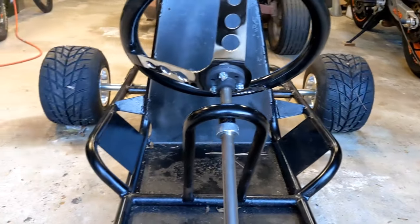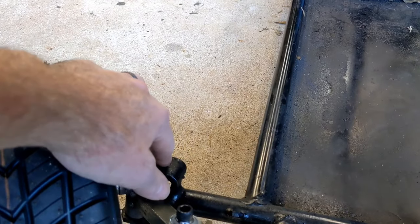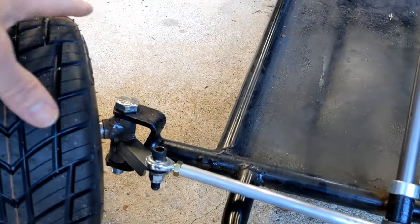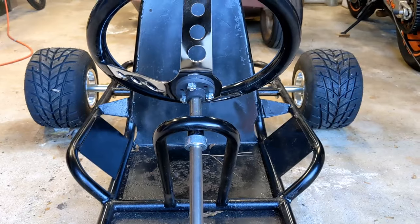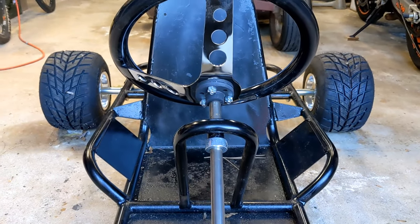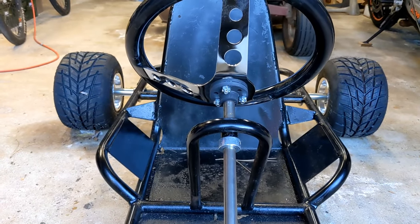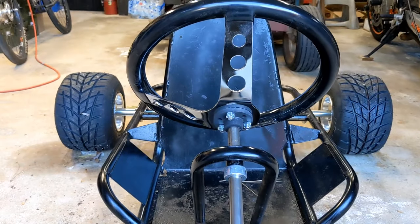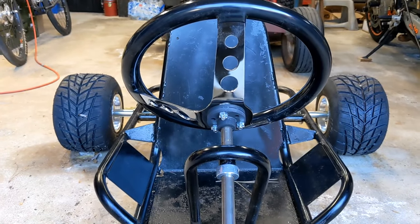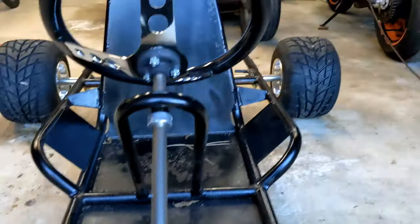It's not going to be pushing as hard in a straight line as it would if you had no caster. If you look at old racing carts — the twin engine ones — they use dead axles, so each engine was powering one wheel. Almost all of those have no caster, or very little caster, at least the ones I've seen pictures of. You see caster a lot more on single engine carts where they're powering both wheels. So there's your hot go-kart geometry tip: make sure you have some caster so your cart will turn.